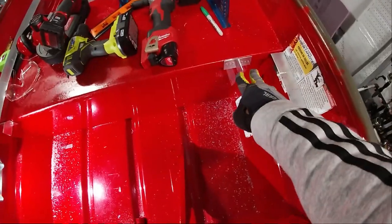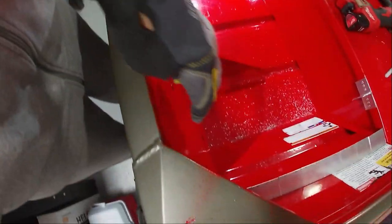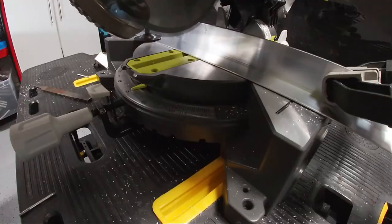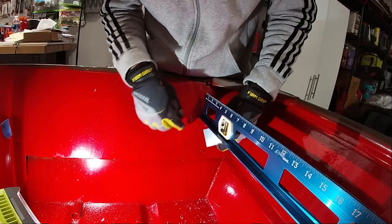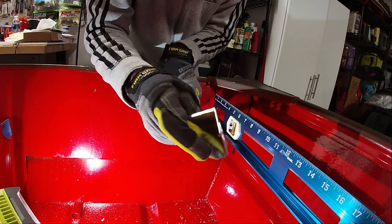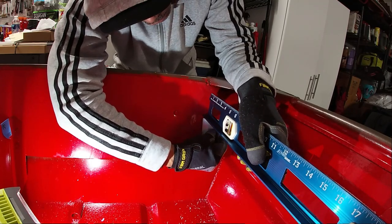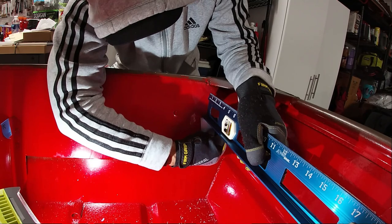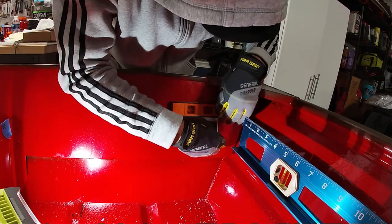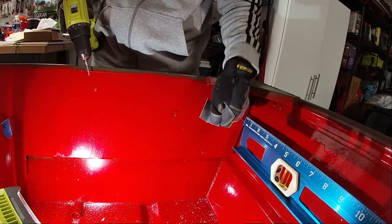We've got our side tracks on and our main brackets on the bench seat, both sides. I'm going to install identical brackets on the transom as well, both sides. I already know my tracks need to be 17 inches long, so I'll make those cuts and get them prepped. I'm using this square to get my 90-degree angle and marked where I need to install the bracket. Using the leveler to make sure I'm at the right height on the transom — it's completely level. I'll drill four pilot holes and check all measurements one more time before drilling into the actual transom.